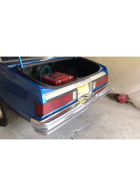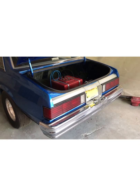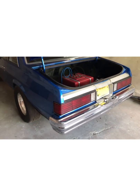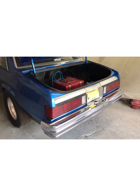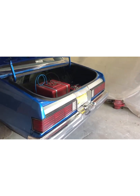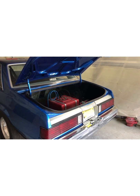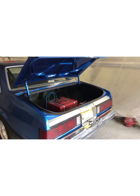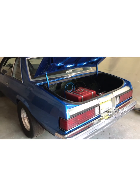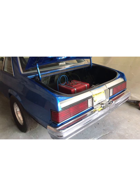The part number will be on screen in a moment. It's a Moroso switch and they're not that expensive — you can get them online and get it all done in a few hours. If you already have a two-wire switch in the car, you need to run a number six gauge wire from the alternator all the way back to wherever the switch is mounted. Don't forget to like and subscribe, thanks for watching.